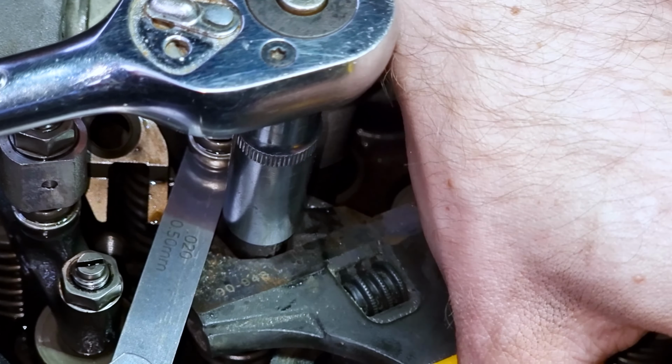Major adjustment is that top screwdriver position, so tighten that down until it starts to get ticked. So he's jigging it around there just to feel for pressure on the feeler gauge, tighten it up, tighten that back up so it's locked in place. And keeping the feeler gauge in, then adjusting the nut. And so tighten that up until it's nice and tight. Or just tight, no more. And then it'll nip back down until it's there and it'll still be moving. Still yes. Good.